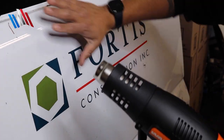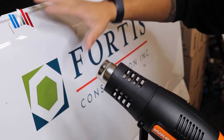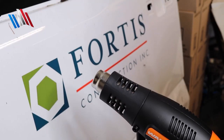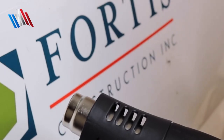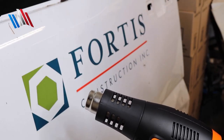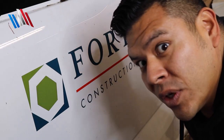If you heat it too much, the metal gets hot and starts cooking the primer, the base coat, and the clear coat. It will start to bubble and you're going to cause paint damage instead of accomplishing your goal. Watch another video — there may be a link at the top where we demonstrate heating the paint too much and what happens. It's a good one to watch.